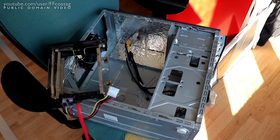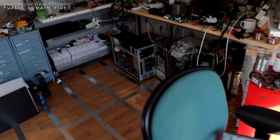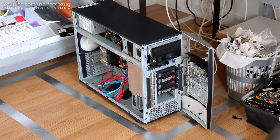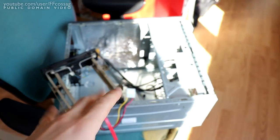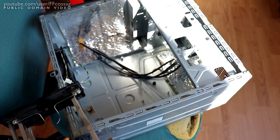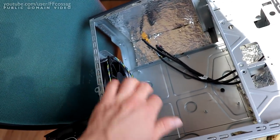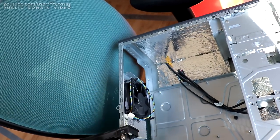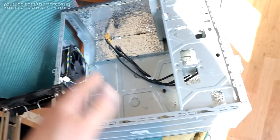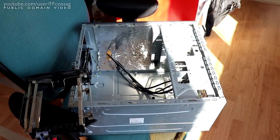Let's just get to work. We need to take the old optical drive out. We don't need to install an OS since we already have that on the old hardware that's going to be transplanted. We need to see what we can do about cooling. Because I'm all about quiet computers, this thing is going to need some kind of intake fan. It does have a rather nice 92mm exhaust and another exhaust from the power supply, but an intake fan might be a nice touch since the CPU is going to see heavy load from time to time.